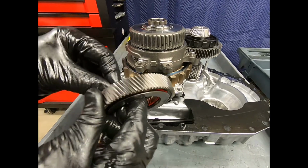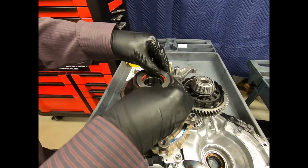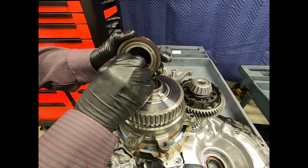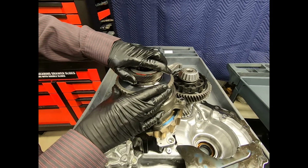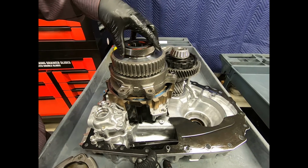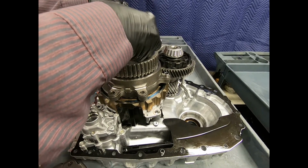is here I have one of the sun gears, and I actually have a selective shim. So I want to be very sensitive about that selective shim. Don't lose it, don't let it get away, and actually make sure it stays in its groove, because it's real easy for it to get offset as I assemble the transmission, and you wonder, well, why? Well, as the case comes together, it should slip right together, flush. If for any reason it does not, you've assembled something wrong. Obviously, just a simple little bit of assembly grease would keep that nicely retained.